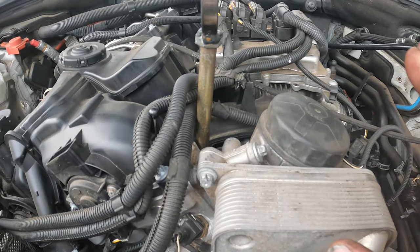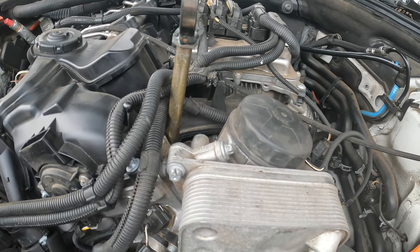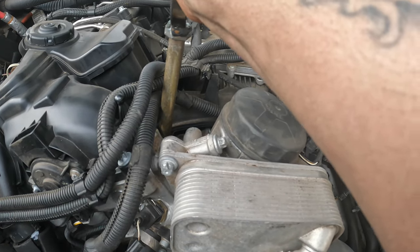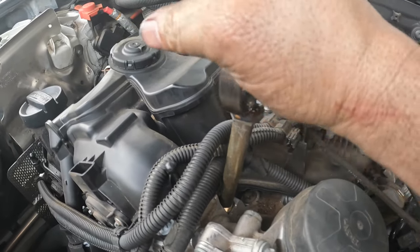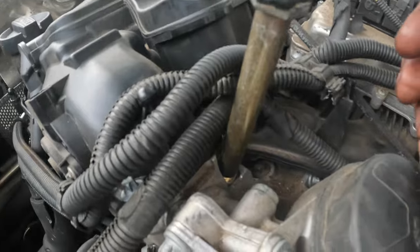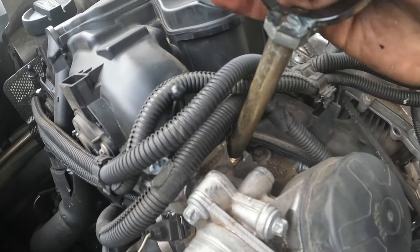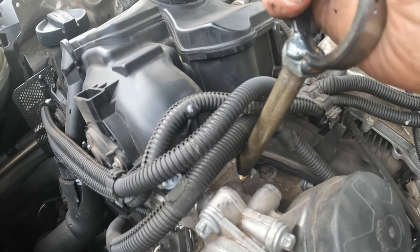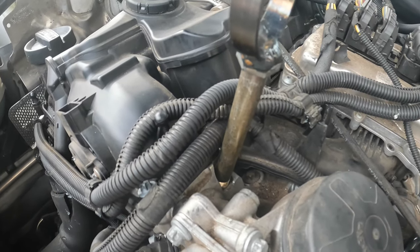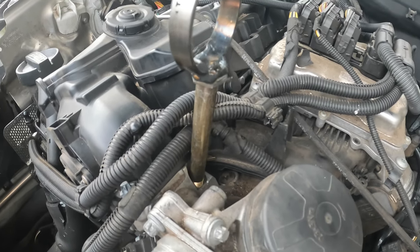I went to the junkyard to try to find a tow hook and this one was the wrong thread. To find out what thread these are: I made my own using a bolt and an old race, just welded it all together. It's not the prettiest thing but she will work. It is a grade 8 bolt — the threads lined up perfect and you can see it threads in and out. You're going to have to have something like this to at least lift the engine, even if you take the subframe out.